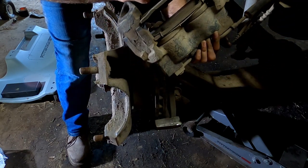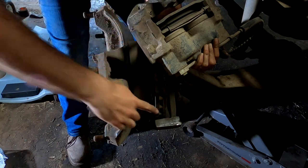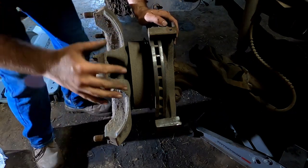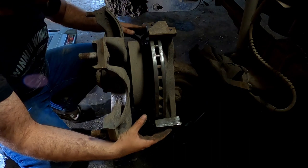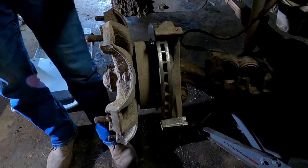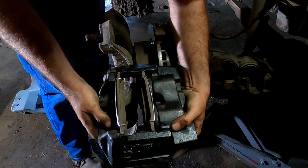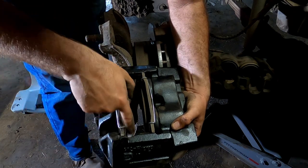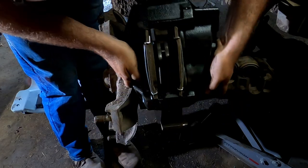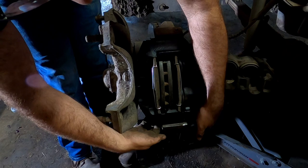If you look on the caliper you've got this shiny metal here from rubbing on the wheel. The problem is these are lips that go here, and if those wear down you lose your ability for the caliper to be retained. There's no bolt-on like most vehicles — the pads come in from the bottom into this groove, they slide each way, and this lip catches on that overhang so it can't come out from the bottom. See how that overlap catches right there? That's what retains it.